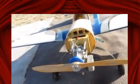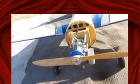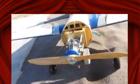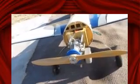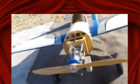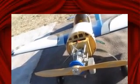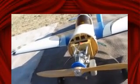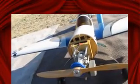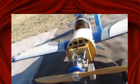The spark plug is an NGK and I've been playing around with .020 gap and .025 gap. I can't really tell the difference — I left it at .025 because that seems to be what people recommend on RCU and other forums, and it works great either way. I think DLE was concerned about going bigger than .025, perhaps because it'd be harder on the ignition to have to generate a larger voltage spike to get over the bigger gap, and probably harder on your spark plug wire and other components due to the voltage having to go a little bit higher. So .025 was the most I set it at.